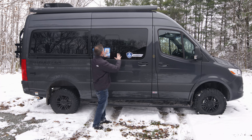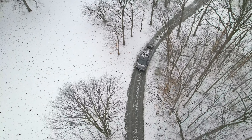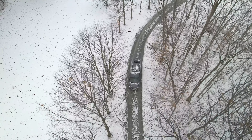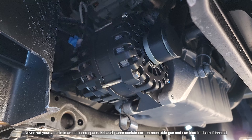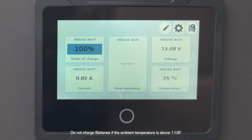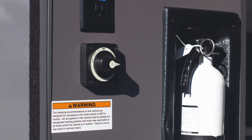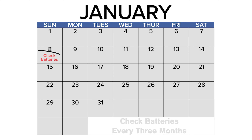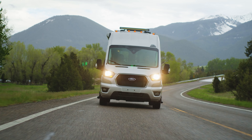What if your van has to stay out here and you don't have the luxury of plugging in? Not a problem. The first step is to charge your batteries — it's recommended to bring them up to 100% state of charge, and you can bring that charge up by starting the engine and letting it run. Taking a drive to bring those RPMs up is going to be quicker. Once you've hit that 100%, turn off the engine, turn off the safety relay, and now the battery disconnect switch. It's recommended you check on the batteries every three months and bring that charge back up to 100%. To charge the batteries, you can plug into shore power or run the engine.